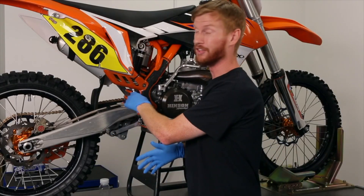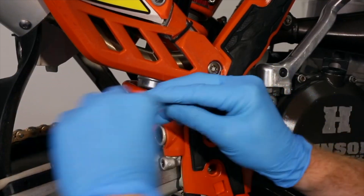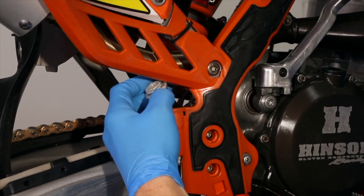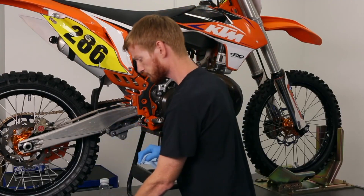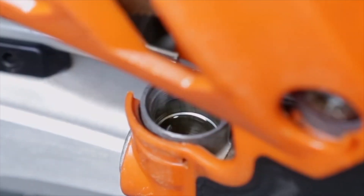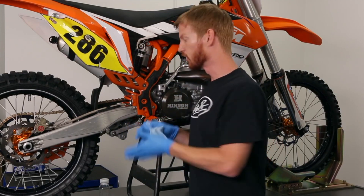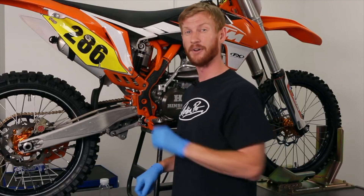The first step is to remove the master cylinder cap to expose the fluid inside. I'll engage my wrench on the cap, break that loose, and back it off completely. With the cap removed, pull it out carefully and use a rag to wipe any contaminants off of it. It's also important to wipe clean any contaminants around the opening of the master cylinder. If the system has particularly old or contaminated fluid, use a clean rag to soak up some of that fluid so you're not drawing all that nasty stuff through your whole system.